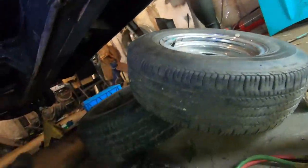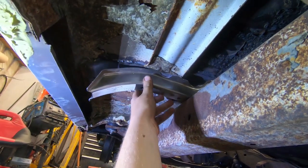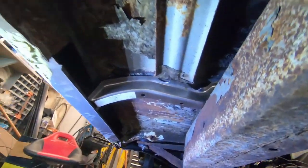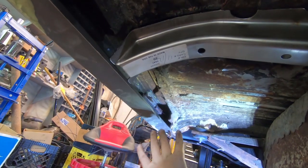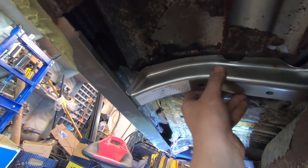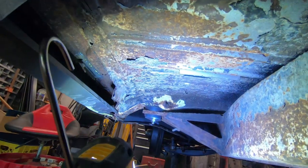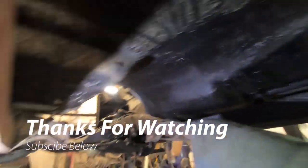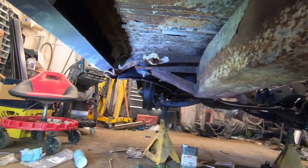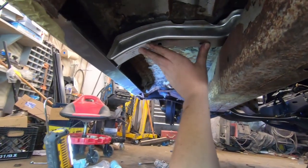While I was under the car - this is the brace, it should fit pretty good, just gotta do a little hammering on it. That's all new metal I welded in. I have the new inner rocker, so I'm gonna trim this all down, make it look nice, weld in the inner rocker. It does have to touch there where the inner rocker would be - buzz that on and there's just one little hole at the front that needs a small patch for some rust. The underside is pretty much done. I've already undercoated this side so it looks a little less ugly but it needs a few more coats. That's it for this video - appreciate all you guys watching, making lots of progress. Hit the subscribe button, like the video, and I'll be back at it laying on my back welding in braces tomorrow.